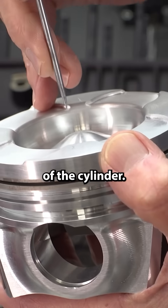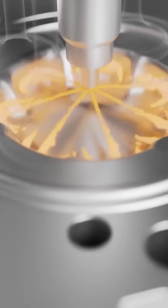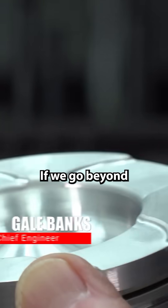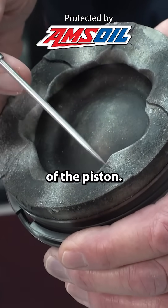The injector is at the center of the cylinder. It injects out at an almost flat angle. So we start injecting, the piston comes to top dead center, goes back down again. If we go beyond 40 degrees of crank angle, we burn this section of the piston.